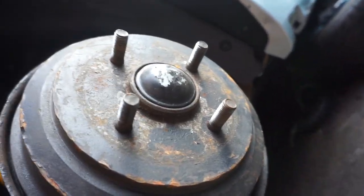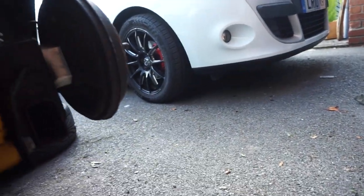As you can see there's a big bolt on the front. I think you might need to remove it - if you want to remove the handbrake cable and the hub separately it's probably easier to do it that way. But I'm just going to undo everything to keep it simpler. On the back there are four bolts that need to be undone - pretty simple, quite easy to do. You also need to remove the wire for the ABS sensor as well.